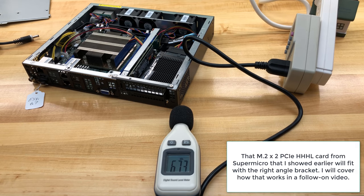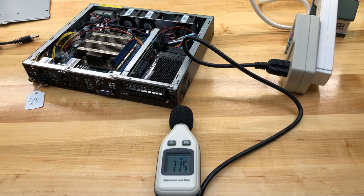The public website doesn't list what type of memory to use. Will my existing 2400 MHz memory for my existing super server actually work? I never got a firm answer — they said try it with the memory you have on hand and let them know. So that's what I'm doing: pulling out four DIMMs from my nearby Xeon D-1541. We're going to learn together whether it works, because the documentation on the website is lacking and I don't think there's even a manual yet.